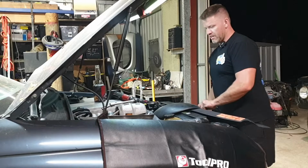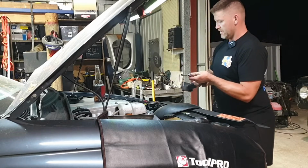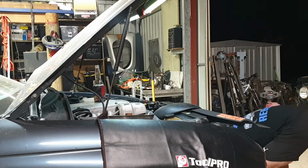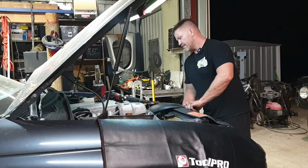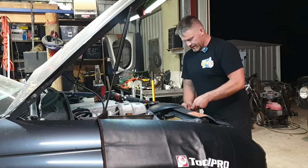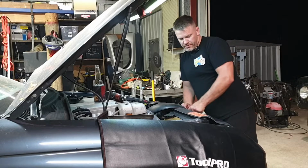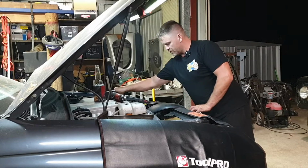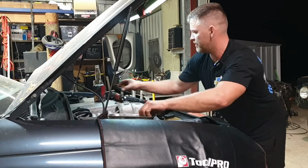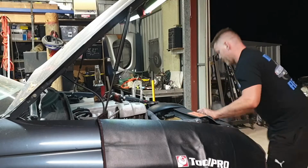What do you want, like the 6-inch one? You're going to start undoing those transmission pan bolts. Leave one of the corner ones in, but just loose. Then I'll come down and I'll show you why. I've just finished all this here. Can you try and not drop the bolts? I'll pass you the magnetic tray. You put all the bolts in that.